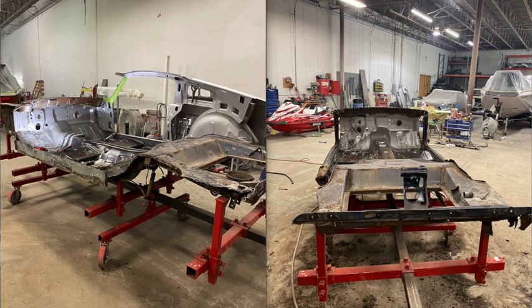As you can see, we're not going to have much of the original car left. Really the only thing we're going to have factory is this upper cowl and just that very front section. Everything else will get replaced. The rear frame rails are in good shape but we're going to do the mini tub kit, so we're going to end up cutting from here to here to get the larger tubs in. This gives you an idea of why I wanted a jig, and why you had to get the structure of the car sound. The coupe is no longer here — here we are, letting the fastback come into it.